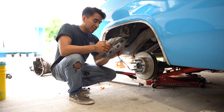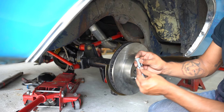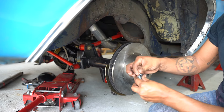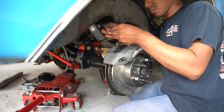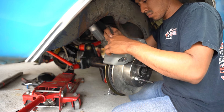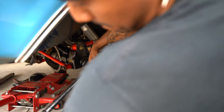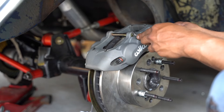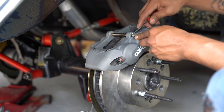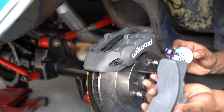We'll put that in and see how it looks. I did have to shim the caliper because the bolt would either hit the back of the rotor or the caliper itself wasn't centered. I found some washers in the garage and used a feeler gauge to get it centered — might have been overthinking it, but I really didn't want to do this again. It worked great. Then I made sure to torque those down and threw some Loctite on there just to be safe.